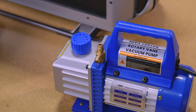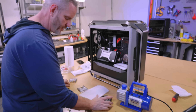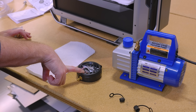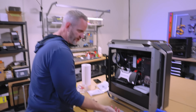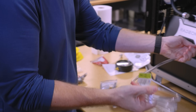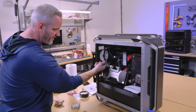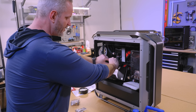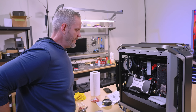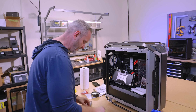Oh — we have a problem already. These are two different fitting types. I wanted to have this vacuum gauge hooked up to it, but I don't have the right connector. That gauge would just tell me when we stopped creating vacuum — it'd be nice to know the needle stopped moving, meaning we've got as much vacuum as we can create. Then I shut the valve off, undo the tube, and the system stays under vacuum. I do have quarter-inch thick wall tubing because I don't want it to collapse. The tube from here to the pump needs to be rigid enough so that under vacuum it's not going to collapse. If the soft tubing collapses and pinches off prior to getting all the air out, that's not going to work.